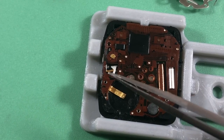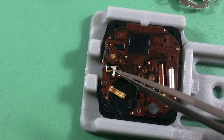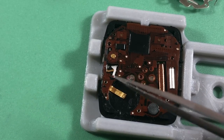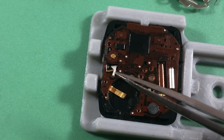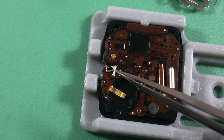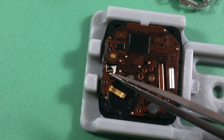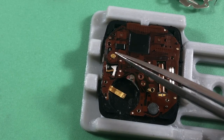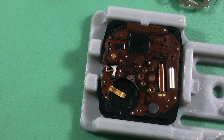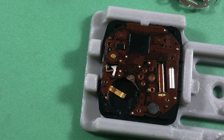As usual with Seiko, there's their crazy obsession with using springs, so this is all sort of like building a house of cards — it has structure and it works, but it's not bolted together so much as it's just keeping everything else in check. This right here is your variable trimmer for doing accuracy adjustment — that should be all straightforward.